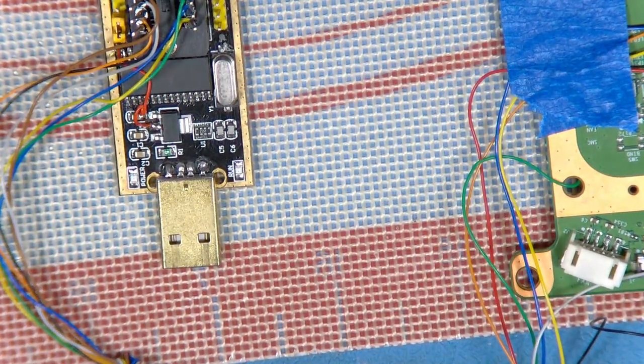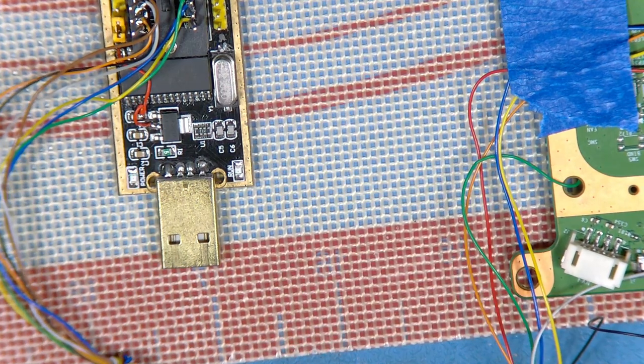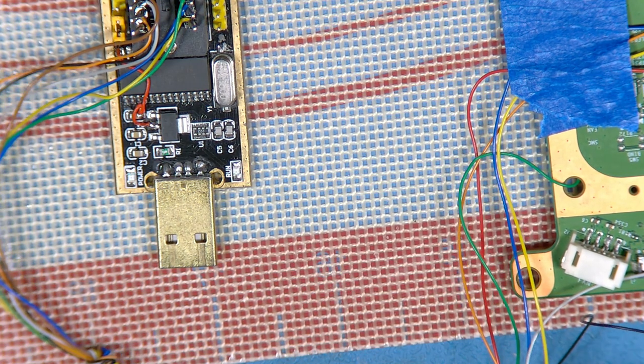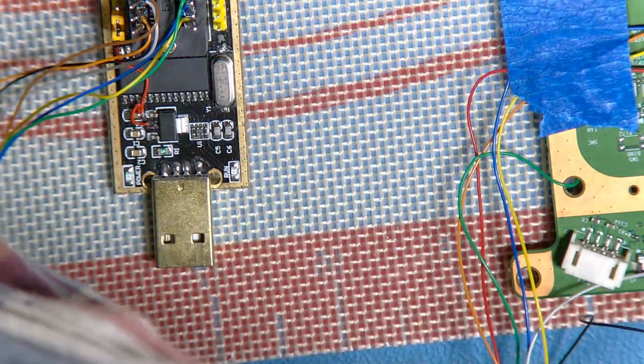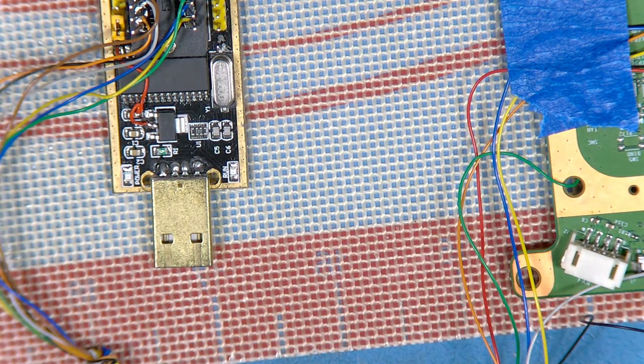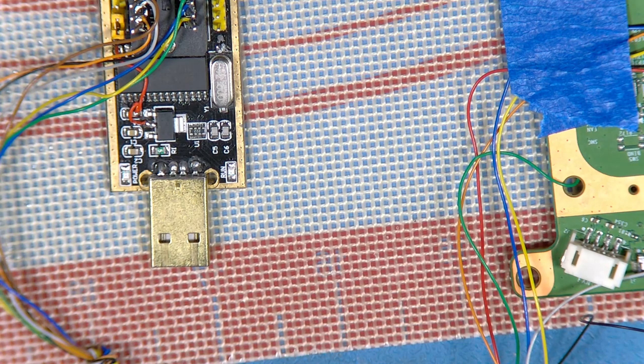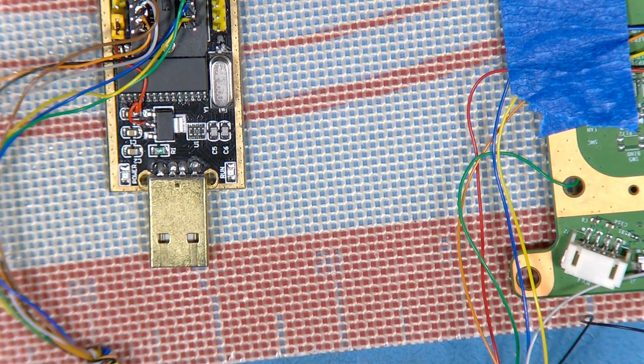Okay, that's in. Right, so we need supply on the board from the power supply, 2.5 volts. The thing is, doing it the way I've done it, where I cut the board, you could actually use the programmer to probably power the chip, because it will work at 3.3 volt, but make sure you've done the mod. Don't run it at 5. That will hurt it. And it should work. Let me see if I can find an extension lead. Maybe that USB. There we go.